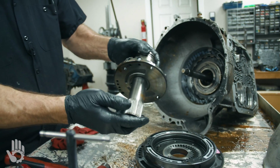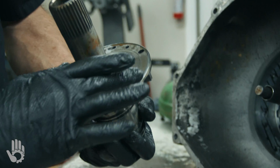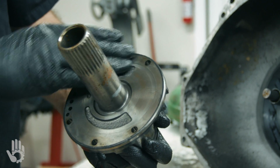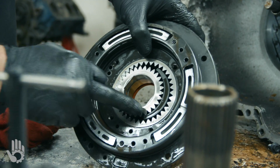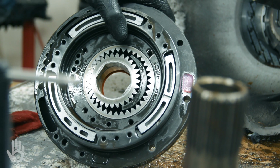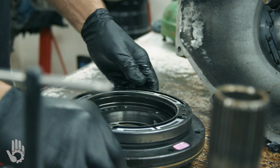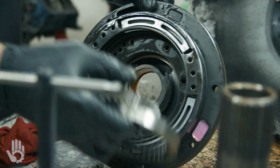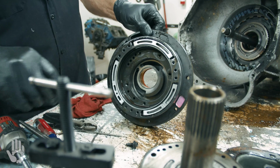Pump cover, or pump stator itself. All right, we'll do a quick inspection on that. Looks pretty good where the gears right there. There's our pump gears. It has the same type of pump as that 400 we disassembled, what's known as the crescent style. Okay. Gears come out of there. I, once again, just replace these as an automatic, if you will, when I build them.